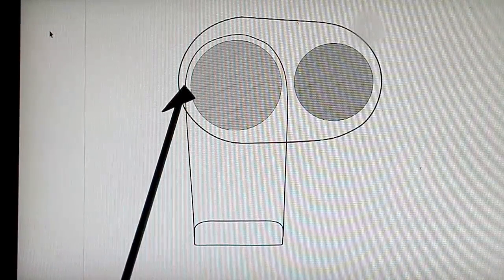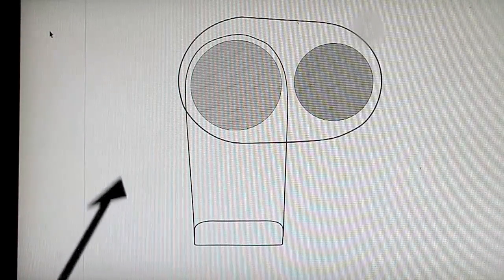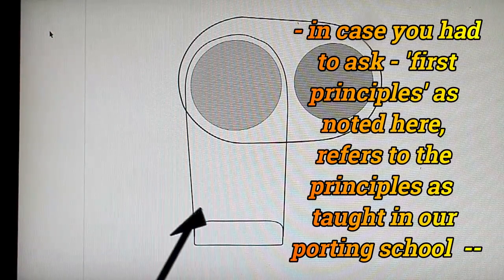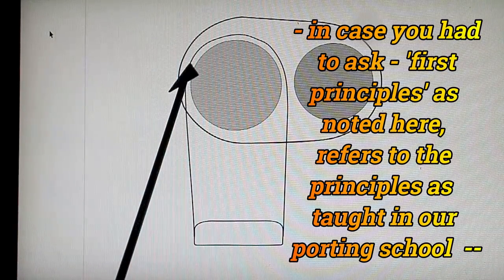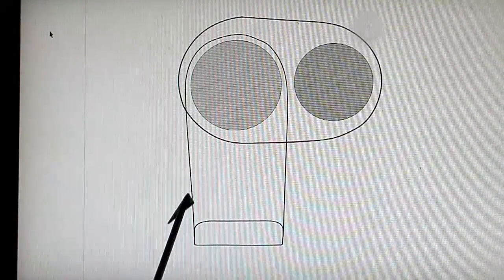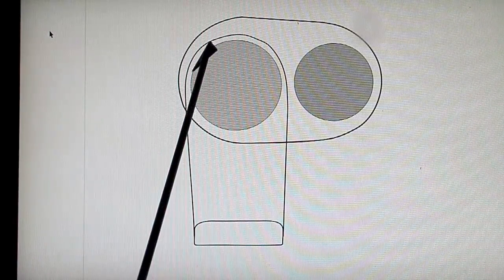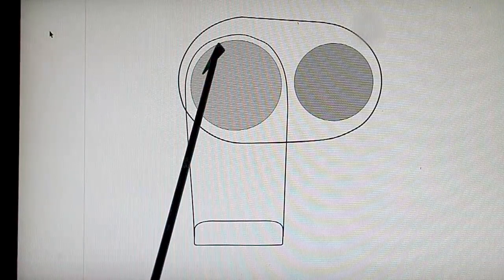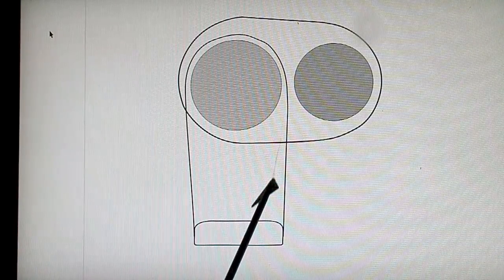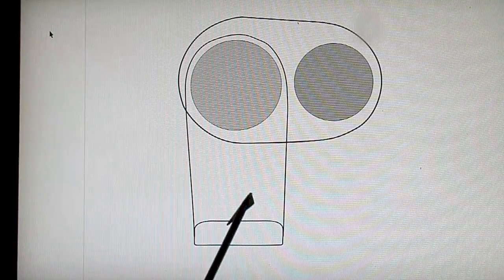Most of our air was coming out from about here round to about here. When I ported it — first principles, because I don't know how thick this casting is — I just took out enough here, between the guide boss, to allow an easier turn for the air. The way the casting was shaped, the bowl at the back was quite a lot bigger than the valve. I also took a lot off this wall and made the port very much straighter, and I got the short side flowing.